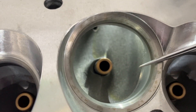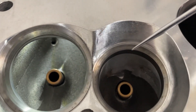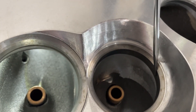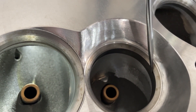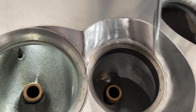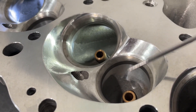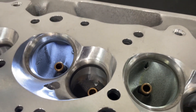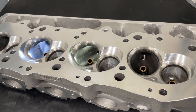Although I don't like the way they did the intake offset, the exhaust one is actually like it's supposed to be. On the exhaust side, we have the angles where you're supposed to have them and it goes straight on the other side — seat, a little top cut, undercut, then straight down. That's right; that's how I do it by hand. So the exhaust is good, the intake has it going the wrong way. That's just my opinion — everybody's got their own.